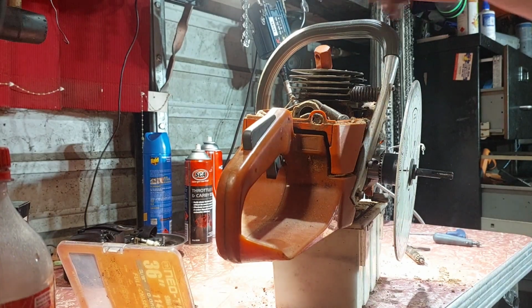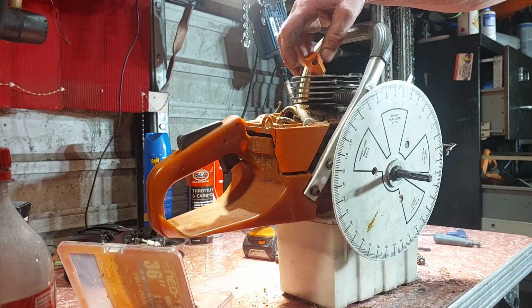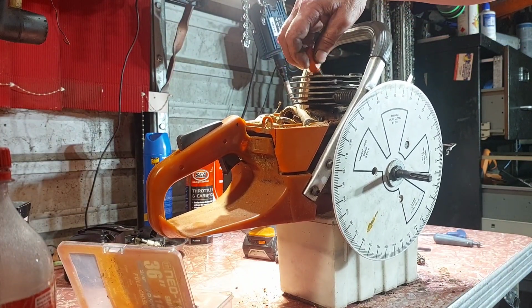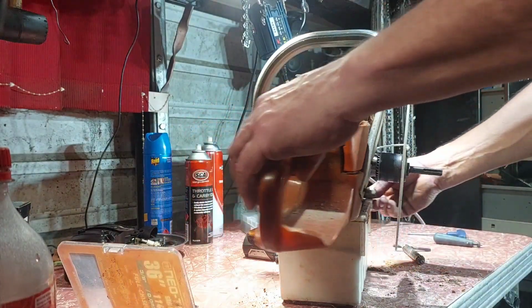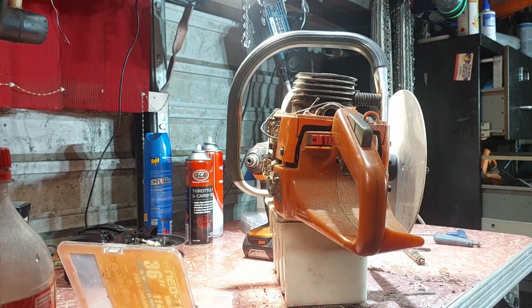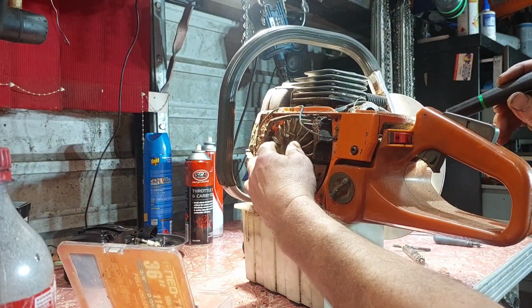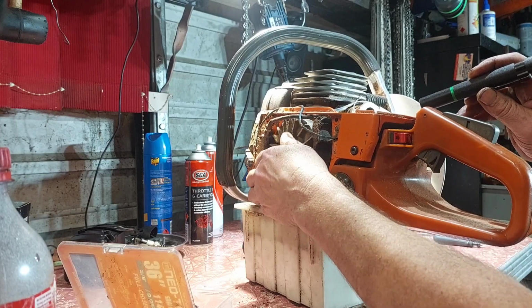Annoying, actually. So I've zeroed in the degree wheel. Zeroed it. So have a look and see what the number is for the intake. I'm thinking about 71 or so. Now, I'll turn you around in a sec. Torch. It's good when things come apart easy, but it's a pain in the butt some days.